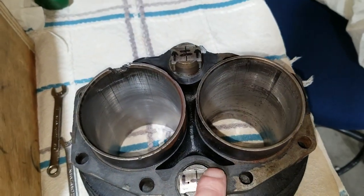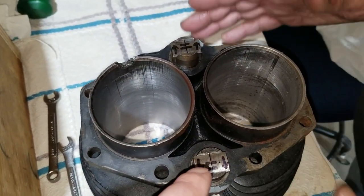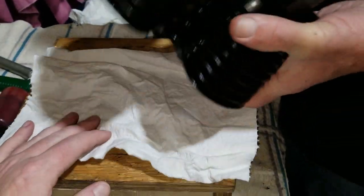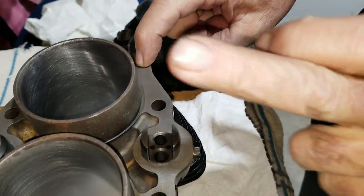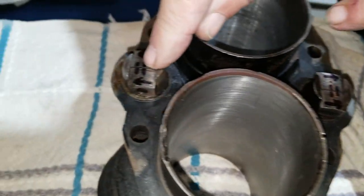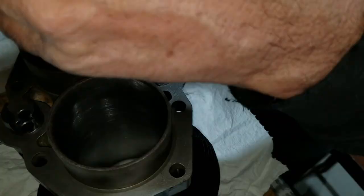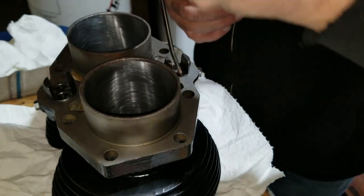But we're going to reuse these tappets because we went with the cam. And we got it marked out how we're taking them out and how they match, so we don't get them messed up. So we'll just do that right now while we're here. This is the only one. So this is exhaust. The exhaust one has holes in it. Oh yeah. See the holes? It oils. Intakes don't. So, no holes. And then holes. So these will go in here. Now I'm going to oil these because these were new. Might as well give it a little first lube, assembly lube.